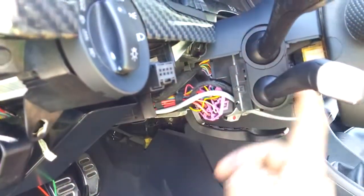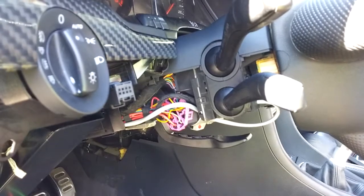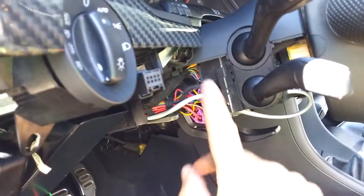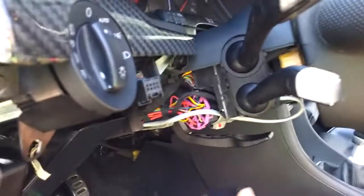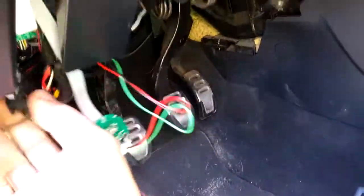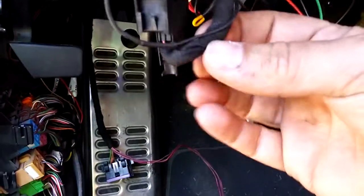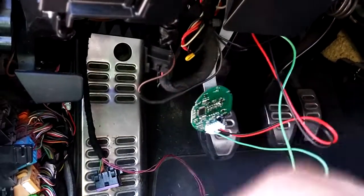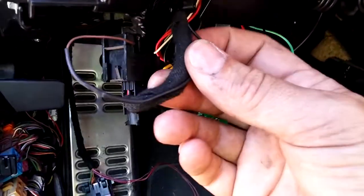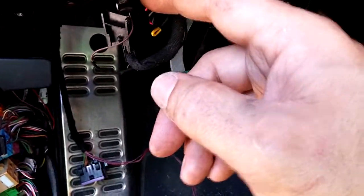Internally they have several resistors in there to send different signals to this module here, which in turn communicates with the ECU and sets the cruise accordingly. The B5 and C5 cruise control was all 100% analog. This connector that you see here in my hand is unmolested from the 2.7T harness. This runs to the orange connector up under the plenum or in the box where the ECU is. This side of the connector is actually the side that connected to the original B5 or C5 cruise control stock up here. And in this box is just basically a small relay to control when the cruise is shut off.